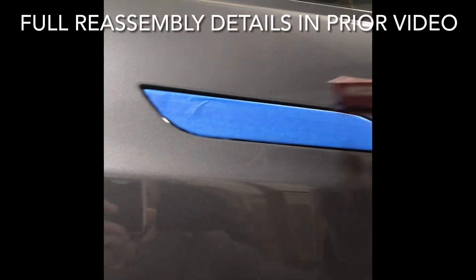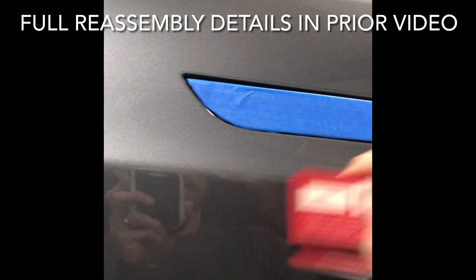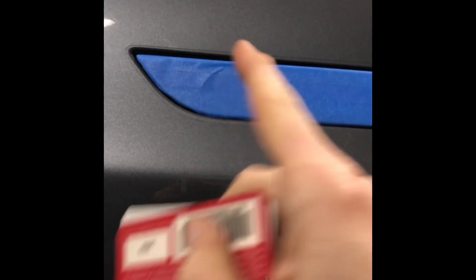Before you tighten your handle up, make sure it's not catching any edges of the door panel. I need to move the back end up just a little. An easy way to do that: grab some plastic cards and shim them in there to hold up the loose handle while you tighten it. Make sure you get a nice uniform gap — this side is great but the back is just a tad low, so I'll pull that up a little.